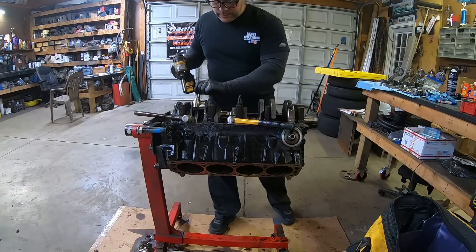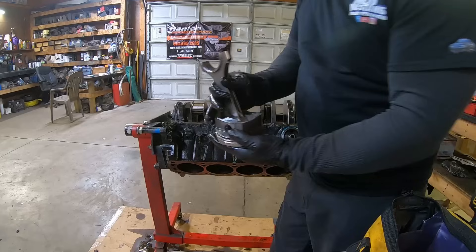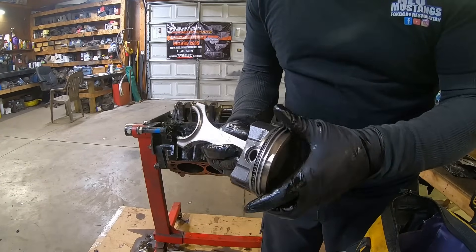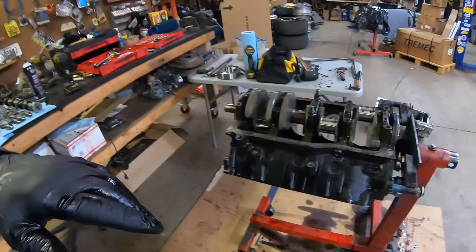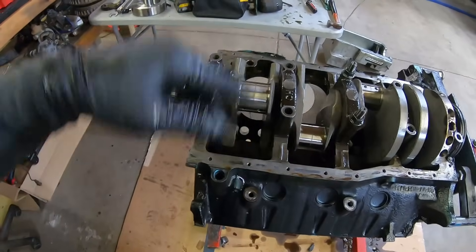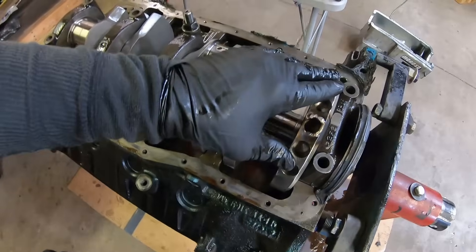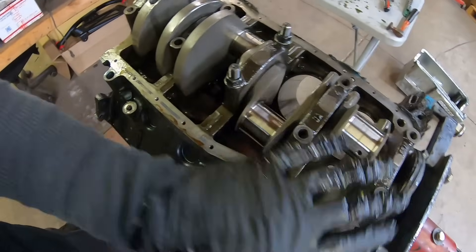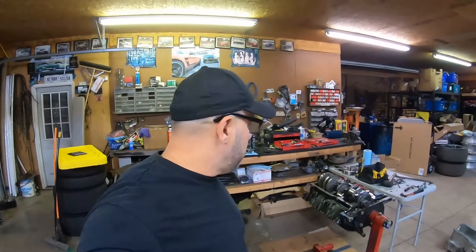Last one - number eight. See what this looks like. Number eight's bottom bearing, number eight's top bearing - piston looks good, don't see any broken rings, a little discoloration there. We're down to our last piece of the puzzle. We're going to put you on the helmet cam and take the crankshaft and main bearings out, which are already pretty loose to begin with. We're going to start checking them. You can see how much weight you've got to take out or add in specific spots for zero balance.